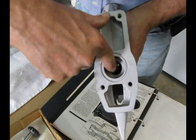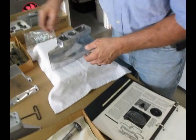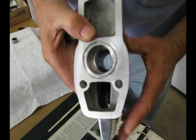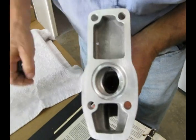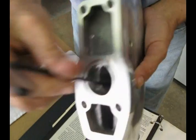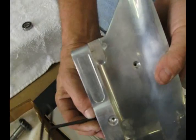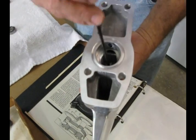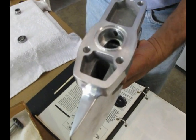That outside oil rifle right there drilled in it — this is one of our early units. This one has been machined for a Timken bearing. But if you notice that oil rifle right here, there's an oil rifle and I'll send a set of drawings. That oil rifle makes sure that the top bearing gets oil to it — we actually pump oil all the way up there.